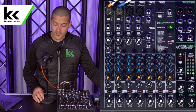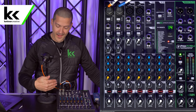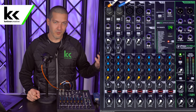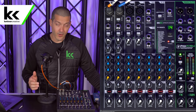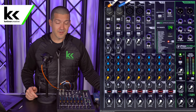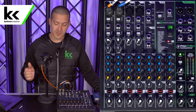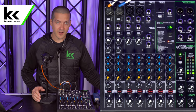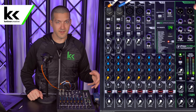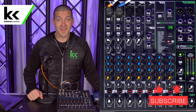So this is the setup I would run with this console — I'd throw the foam filter on, I don't think you need a cloud lifter, I'd plug it in with gain at 75%, and leave everything else bone flat. This microphone is already pre-optimized in terms of its frequency response for podcast recording — I don't think you need to mess with it too much. I hope this video is helpful. If you want pricing or specs, check the links in the description. If you have questions or comments about this setup, please ask in the comment section — I will get back to you. If you want to see more videos like this, we have a huge playlist about the Mackie ProFX and the PodMic, so please like and subscribe. Thank you so much for watching.